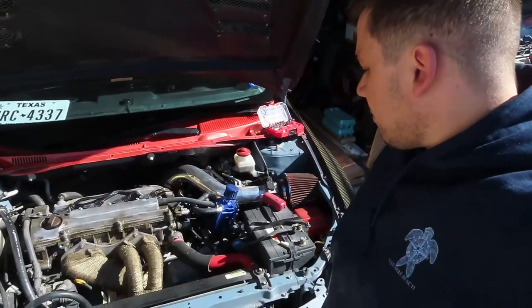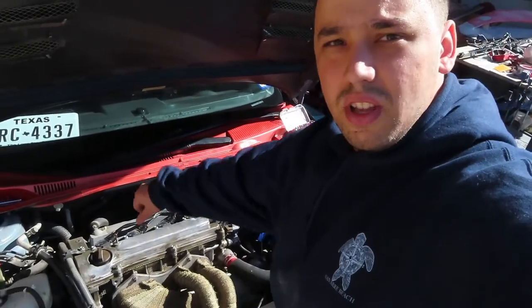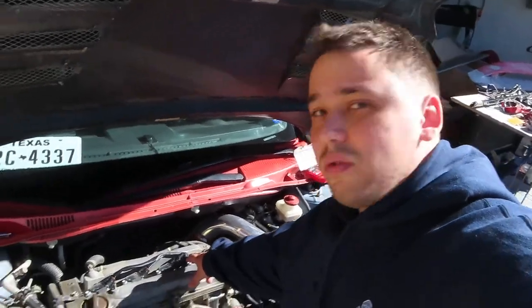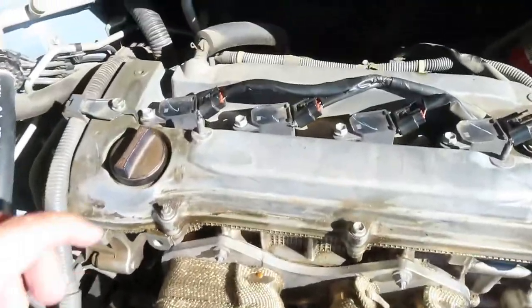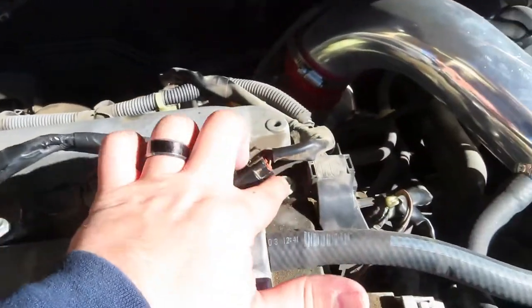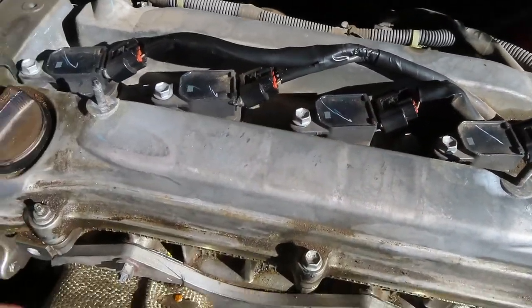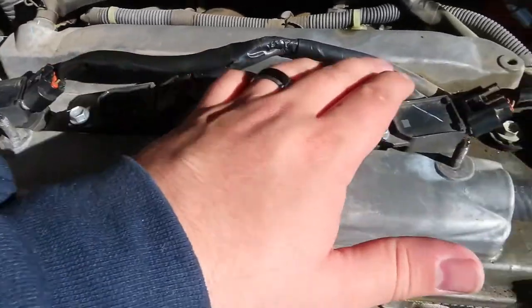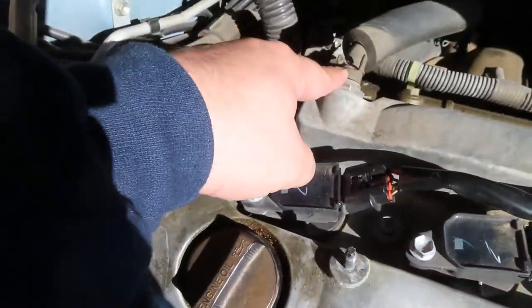So first things first, I already took off the engine cover and the two simple bolts that kept it together. They were 10 millimeter, and all these little tiny bolts right here. Hold on, let me bring the camera in for you guys to see better. Alright, so you got this bolt right here, that's 10, all of these are 10 millimeters, alright? Every single one that you see like this, those are all 10 millimeters, alright? So we're gonna go ahead and pop these off first, and then we need to take off this hose right here,